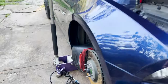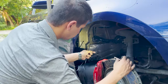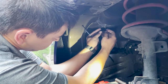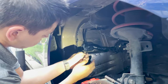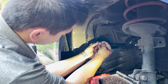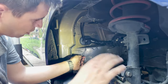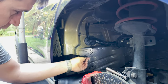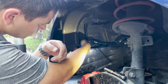And then I'm gonna grab a couple zip ties. Okay, so then I got a couple zip ties. And all I'm going to do is put one at the top and one at the bottom, just to keep that polyloom from coming off. So that one at the top, one at the bottom, and I did put it on the grommet side to try to tighten it and keep that from coming loose. And then just with my wire cutters here, I'm gonna just trim those, hopefully.